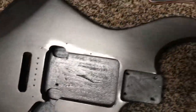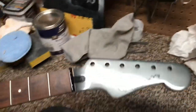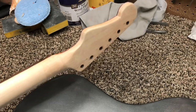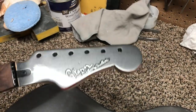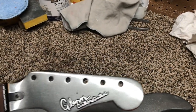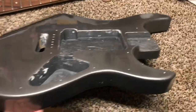Be careful — this foam can burn through your clear coat pretty easy, so you have to keep moving and don't stay in one spot. When I first started using the foam pad I used to burn through the clear coat, and it would make me so mad because I'd have to restart pretty much all over again. But I learned not to do that.